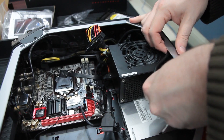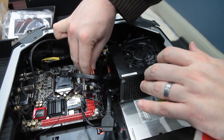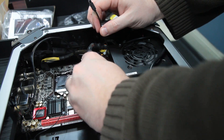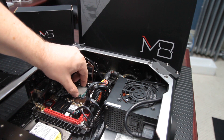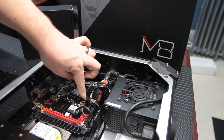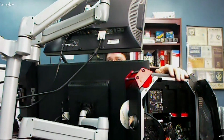Are there any more specs on the motherboard? It's a Z87 ITX motherboard made exactly for this chassis — the model number is the Z87-M8 from ASRock. You have to get it with the case. It doesn't have anything proprietary — no proprietary power connector, no proprietary anything else. The only thing slightly weird is that it takes notebook RAM. We've got some ADATA notebook RAM. The system is configured with an ADATA SX910 SSD and the Velociraptor in a caching configuration, because Haswell does that really well.